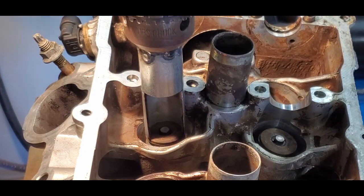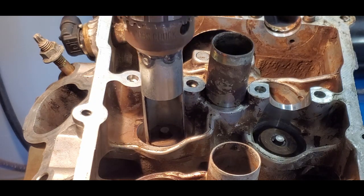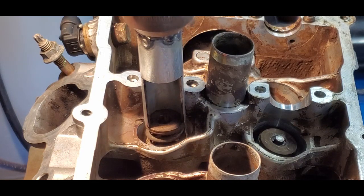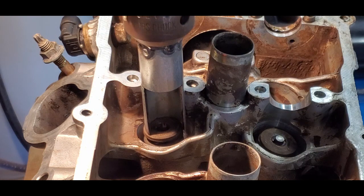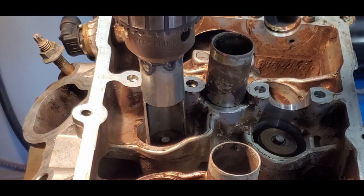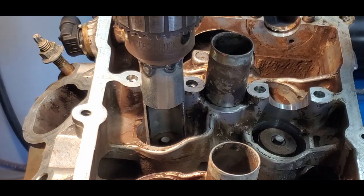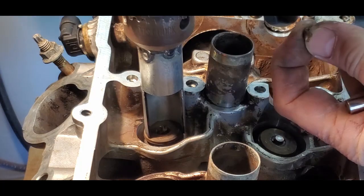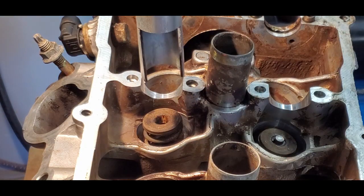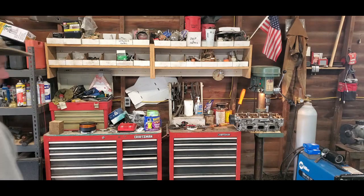Okay. Now this is going to pop up over the top of the cylinder or the valve. See how high that spring had to be compressed? Because now when I put this back together, which I'm not going to try to do at this moment, I'll do this right down over the valve, and then by hook and crook, I'll put these little guys back in place, release it, and life is good.